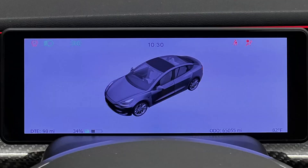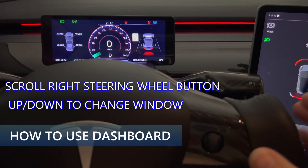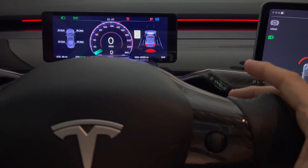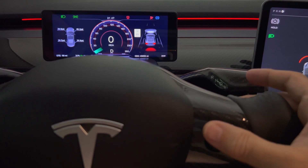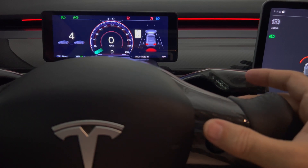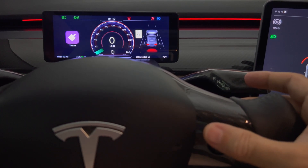The settings are updated. We see the main screen shown while the car is in park. Things like distance are now in miles instead of kilometers. To see the dashboard screen, put the Tesla in any gear other than park. Scroll the right steering wheel button up or down to change the window on the left of the screen — down moves to the right and up moves to the left. There are a number of options: the default view is the tire pressure diagram showing all four wheels, then autopilot follow distance, then theme, and then setup.